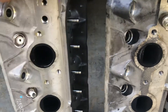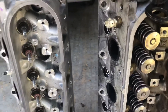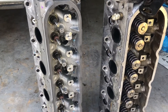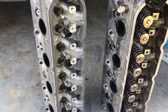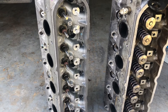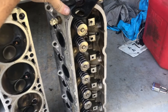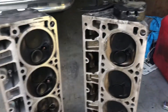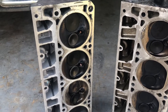All that stuff helps it make more top end power. From the dyno results I've seen, you're probably talking about a 30 horsepower jump by doing that swap to LS3 heads — and I'm going to port these heads too. They do have a bigger combustion chamber than the LS2, so it will give you a drop in your compression ratio if you just put them on without milling them down or running a shorter head gasket.